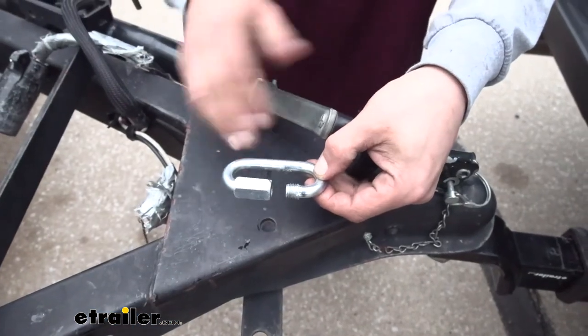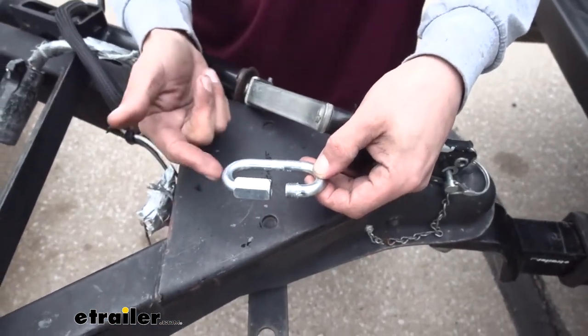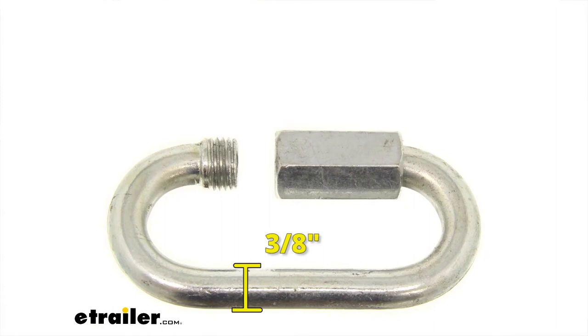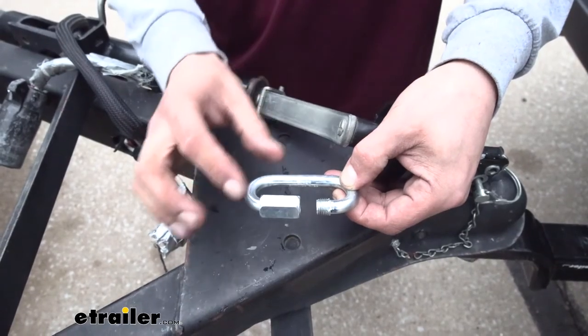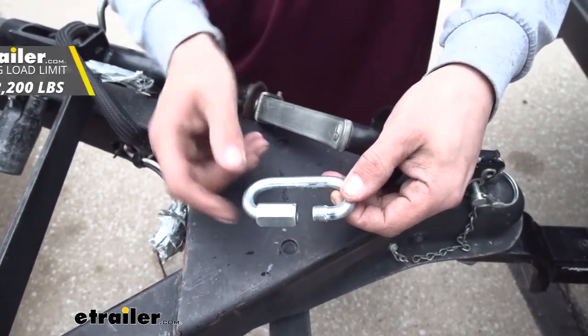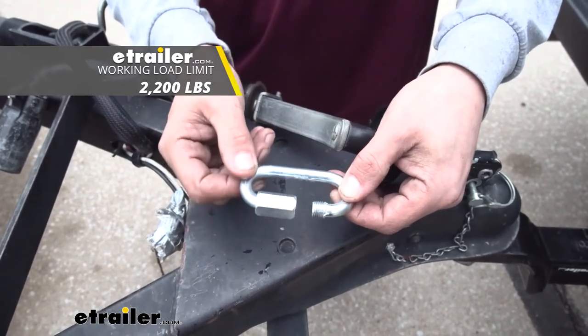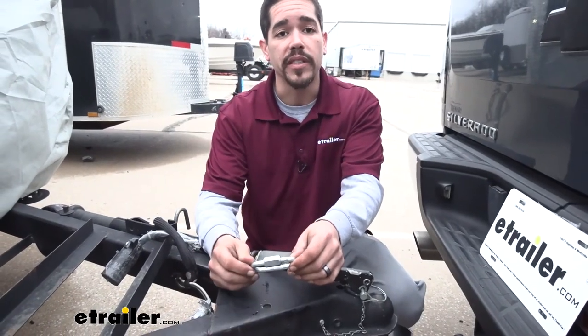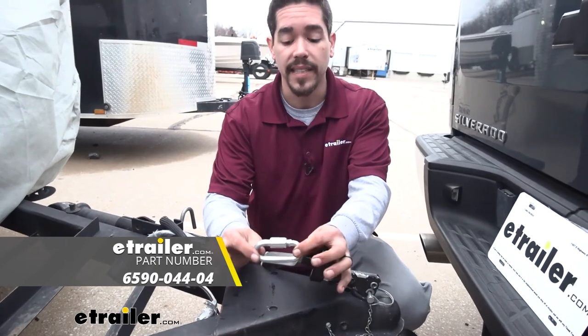A few measurements that are definitely going to help you when looking at these quick links: the diameter is going to be 3/8 of an inch and the opening right here is going to be just under a half an inch. The depth from the inside of the nut to the inside of this wall is going to be just under three quarters of an inch. So you want to double check your application and make sure this is going to fit. You also want to make sure you're not exceeding the limit — these have a 2,200 pound working limit, so double check your trailer and all other components. I'm Rob here at eTrailer.com and that'll finish up your look at the Laclede 3/8 inch QuickLink.